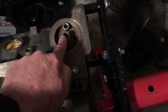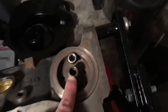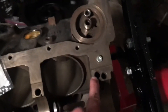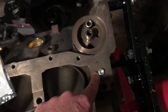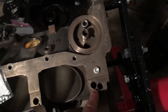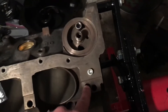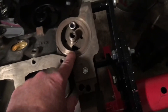The oil goes into this cavity, goes through the filter, then comes back out the filter and goes out through that hole right there. It comes back in through another drilled hole into this very same hole, and that's the hole that leads to the oiling system for the rest of the block. The plug goes partway down — past the hole going out to the filter, but before the hole coming back — directing oil over to the filter and back. That plug is basically to divert the flow of oil into your oil filter.